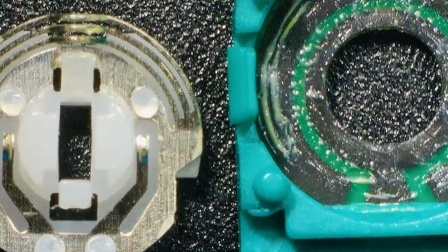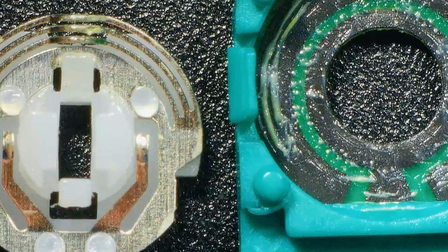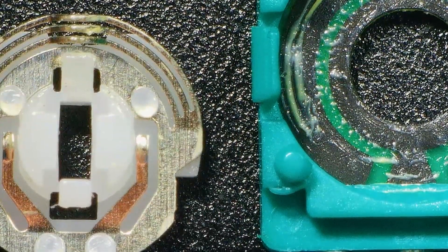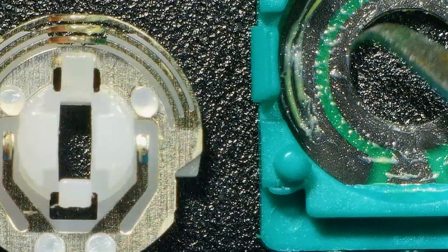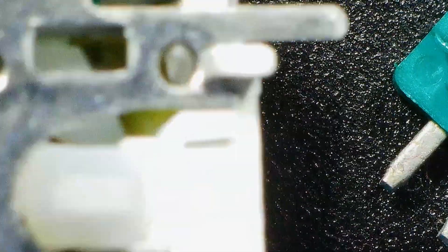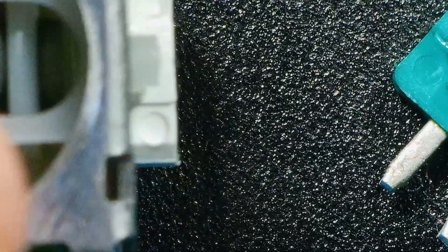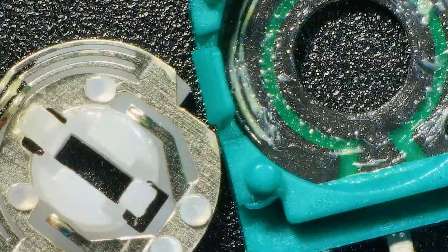When you do, try and get it into a shop. There's no way to fix it with any lubricating fluids — it's more of a paste, more of an oily gel — so you need to dig down into the controller anyway to fix this. So if you're in the controller and the guts of it, just replace the full thumbstick, which obviously comes with the two potentiometers and the thumbstick as well, and everything that you need. It won't take long. You're better off replacing both at the same time — if one has stick drift on the left, I guarantee you the one on the right will have it not far behind.